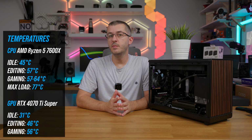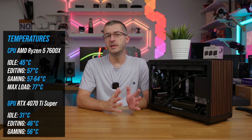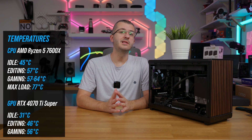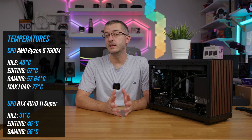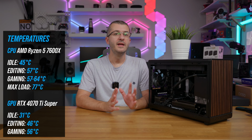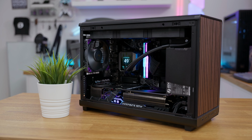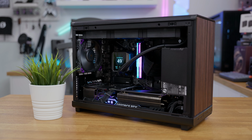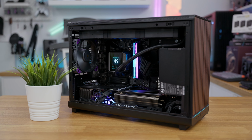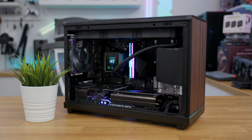Temps for the GPU while gaming are 56 degrees, that is on average 1 degree hotter than classic mid-tower cases. The CPU is literally cooled the same, idling at 45 degrees, 57 to 64 while gaming, depending on the load of course, and maxing out at 77 degrees. Since this case is for a very niche audience and specific builds in mind, once again do some very good research on which stuff you can fit in here. You can check on Lian Li's website, I will leave a link in the description, they have this explained very thoroughly, so check it out.